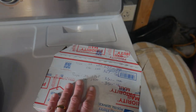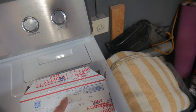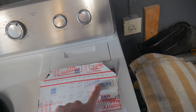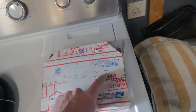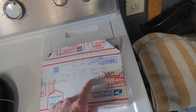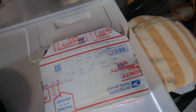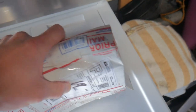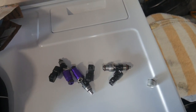In here I have my injectors. Scribbled on here is the before flow test and the after. They were flowing really, really poorly — one of them was only able to get up to 948, and the others are 1700cc injectors. Even after cleaning we're only at 1380 and 1400. You can definitely run a rotary with that — the stock injectors are 550cc — but when you put these injectors in, programmed to run as 1700s, and they're not flowing correctly, you're going to run into fueling problems and blow up the motor. So unfortunately these beautiful Injector Dynamics injectors are, as the Germans say, kaput.